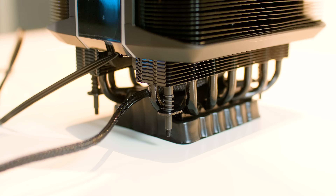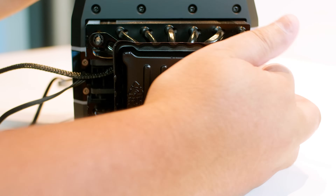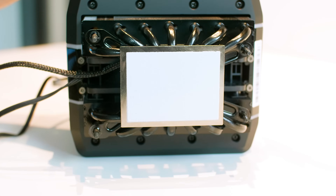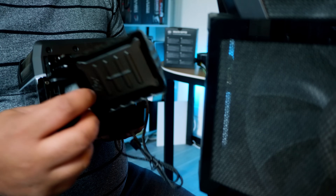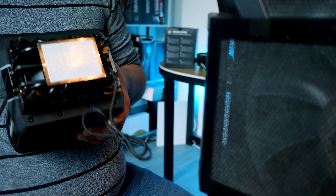you're actually rotating the screw that will hold it into the socket. The thermal paste is pre-applied, so you don't have to apply any of your own at all. For CPU coolers for other sockets, I don't mind if it's pre-applied, but for Threadripper this is a welcome change. Threadripper is traditionally a socket that has a different thermal paste application to any other type of IHS, so taking that out of the equation is pretty nice.